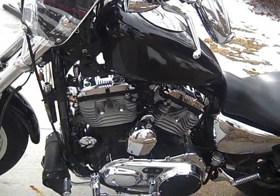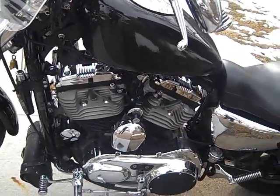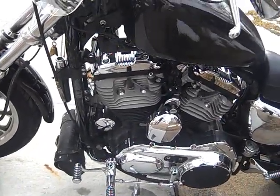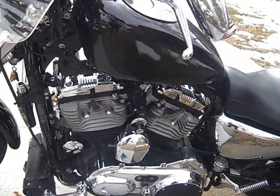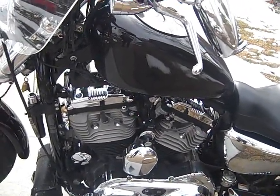The engine — immediately upon receiving the bike I disassembled it. Balanced and blueprinted everything; every component weighs the same. All the valves weigh the same, all the rocker arms, every part in the engine weighs the same. All the gears were undercut for speed shifting without using the clutch, and I drilled lightning holes in all of the gears.